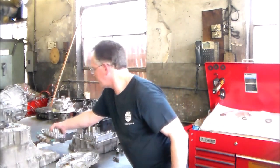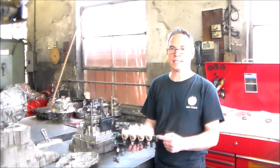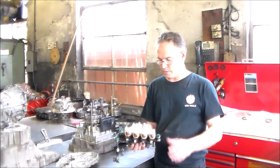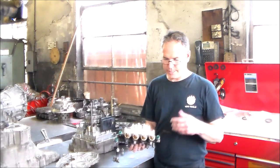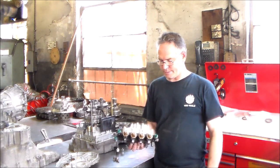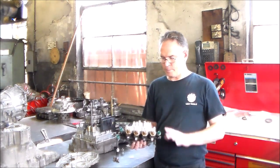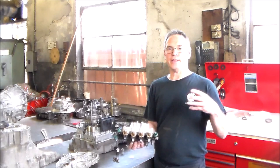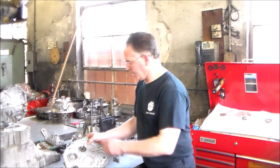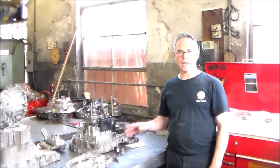For instance, I did a 6 speed Honda in a 2012 Odyssey, and this one has 6 of them. I changed the whole secondary valve body — very reasonable, just a couple hundred dollars with all the solenoids and everything, because that guy was an Uber driver and I didn't want him to have any issues. Generally the Honda solenoids are very, very good. Switches 1, 2, and 3 are all the same — I bought this whole setup which changed those three switches, then bought the other three that go on the covers. Again, high failure rate.